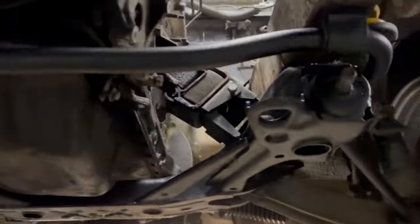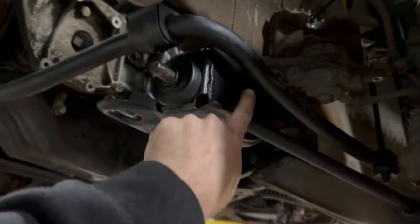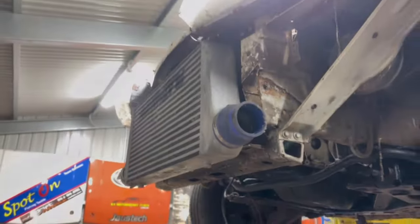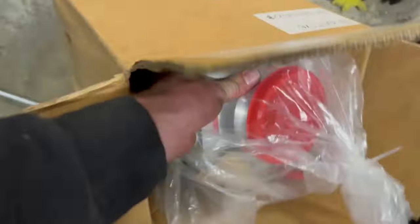Mint. The other thing I really wanted to double check was sway bar fitment. So VN sway bar, also good to go. It's not fully bolted in, but she's pretty much in there. I just wanted to double check that the K-frame wasn't a different shape here and that the sump clearance was all good, and she's mint. So yeah, that will wait till next week. Next week's video, I'll be making a turbo manifold from scratch